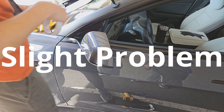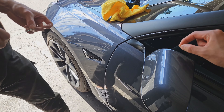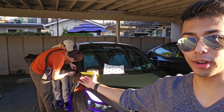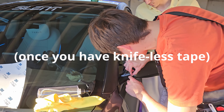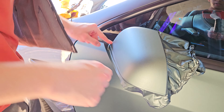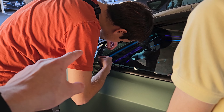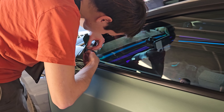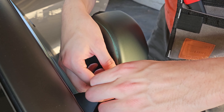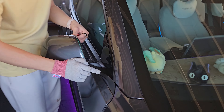You can see how much left over we have right here — that's all going to get tucked for our seamless look. Whenever you're using vinyl wraps, heat guns are a great tool; they can fix any kind of fingers, not just on the edges but the sides too. The only thing is you don't want to leave the heat gun on too long, otherwise you risk burning a hole through your wrap. We'll use our tuck tool now — once the fingers are pulled out, push the wrap underneath the edge. Be super careful because the edges of the tucking tool are sharp and you might cut your wrap. Cut just a little bit of excess off, careful not to scratch anything, then press it in between the two plastics and fold it right over. Not too bad!